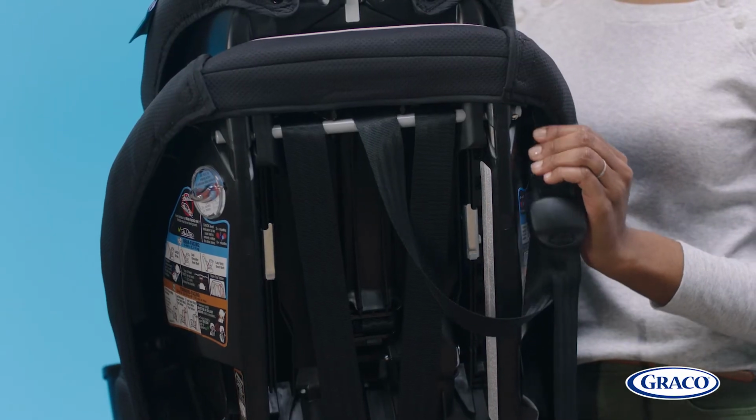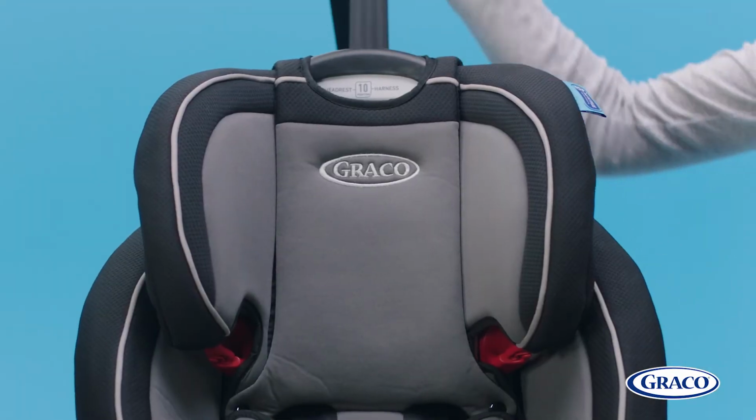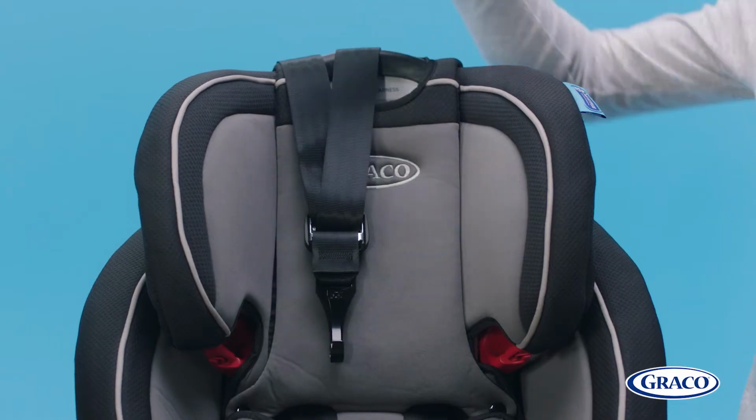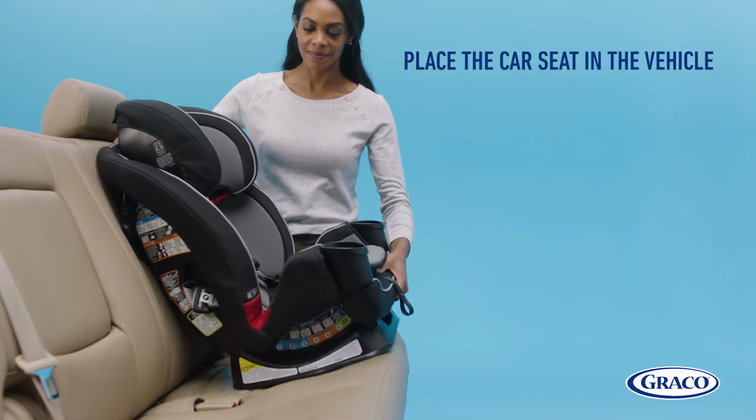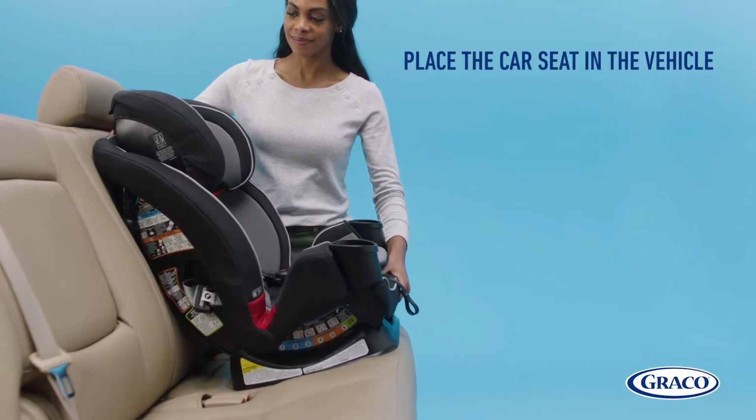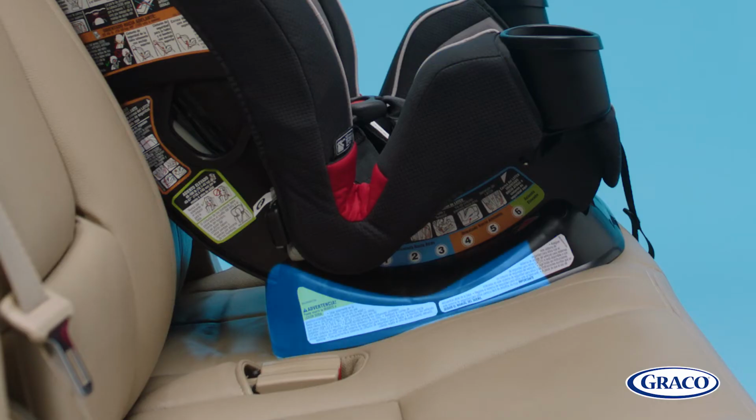Unhook the top tether strap from storage and place over the front of the car seat for easy access later. Push the base against the vehicle seat and make sure the car seat base is flat against the vehicle seat. Make sure at least 80% of the car seat base is on the vehicle seat.